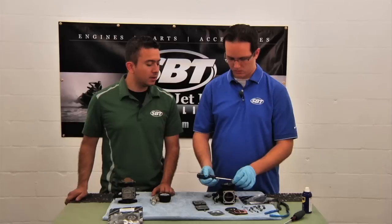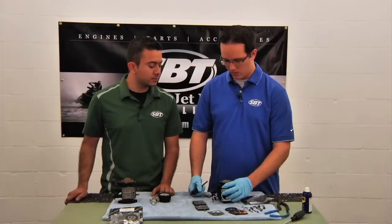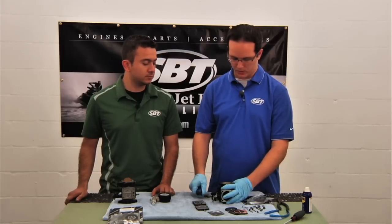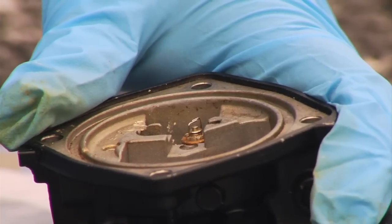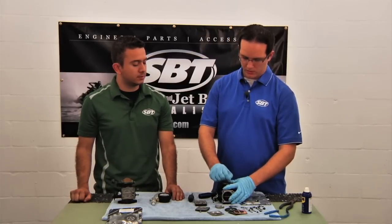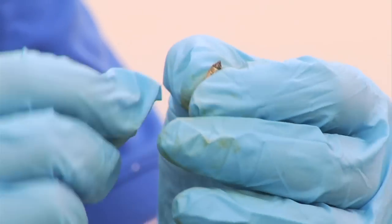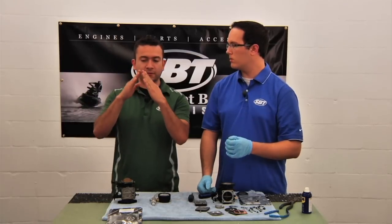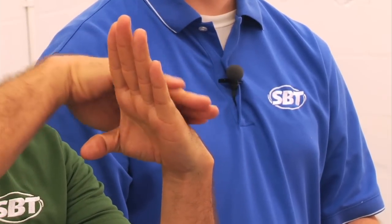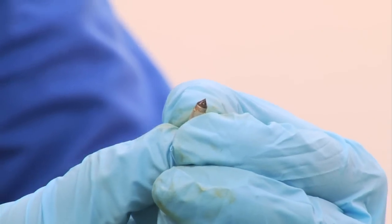At this point we can start rebuilding. How about the jets — are you going to replace the jets? No, actually these jets are in good condition. The only time you'd really want to replace jets is if you have any type of corrosion inside the actual jets compromising them. I can see that you left the needle and seat there. When would you go ahead and replace those? You want to replace the needle and seat mostly when you can see that the tip of the needle actually winds up indenting. The tip should be perfectly even all the way around; when it develops an indentation right on that tip section, that's when you need to replace it. Exactly — you'll be able to tell when you look at the tip; you'll see a line when you hold it up to the light.